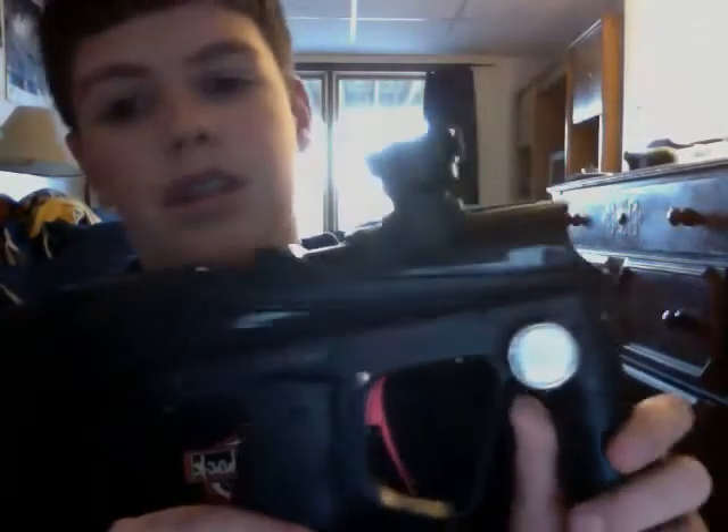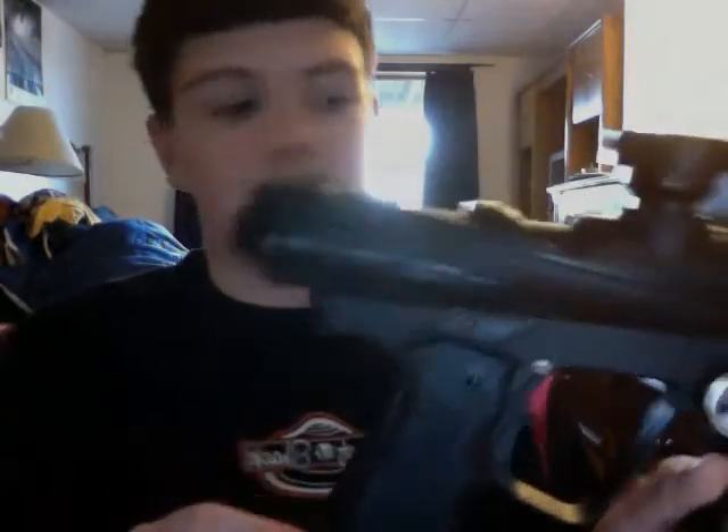There's a guy on TechPB who had a problem with his ASA — it was leaking through the bleed hole, which as you can see is right there. If it's leaking through here, then most likely your pressure is up. It's not a broken O-ring or anything. If it were a broken O-ring, it'd just be leaking out through the ASA.